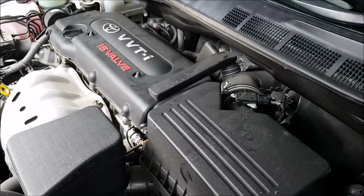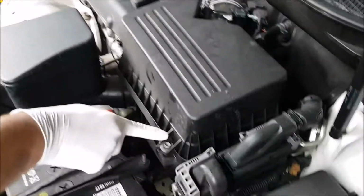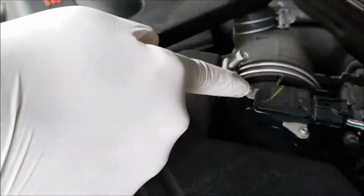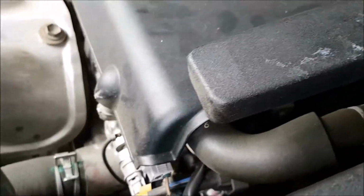And I'll put a link in the description. So what we need to do is take off this 10mm bolt, as well as another two 10mm bolts at the back, as well as loosen the one in here where it goes through that air vent, and I believe it goes through to the throttle body.